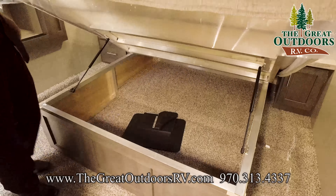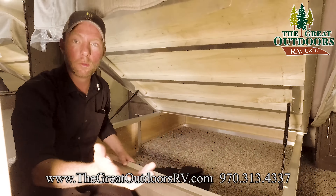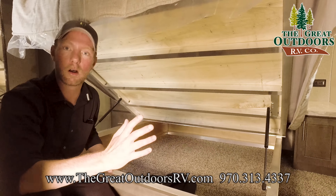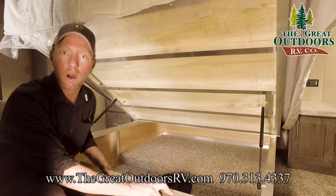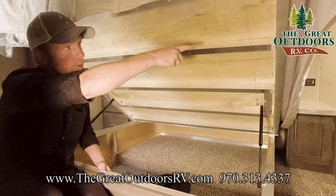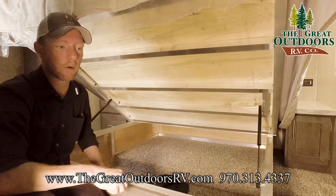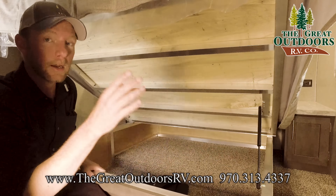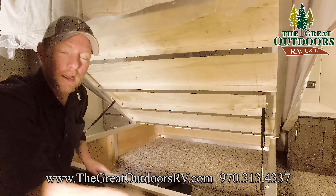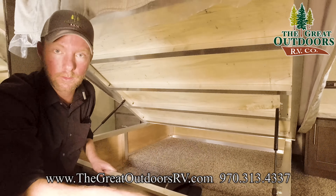Something I like to mention: a lot of companies in the industry say they're aluminum framed, but that's typically only true in their sidewalls — usually they have wooden roof trusses and wooden rear walls, and everyone uses one-by-one wood framing in their beds and dinettes — except Rockwood. Rockwood does it with double welding on every joint, full welds not just tack welds, on all their aluminum framing, and that's true in your roof trusses too. The only wood you'll find in a Rockwood is five-eighths tongue-and-groove marine grade plywood in the decking, in the cabinets, and of course in the name.